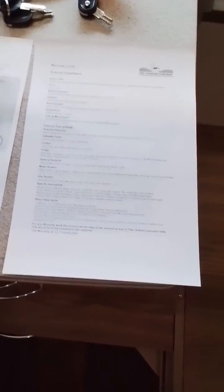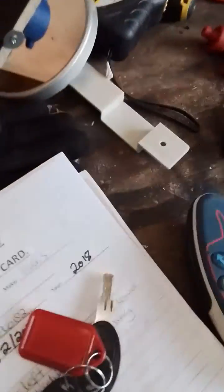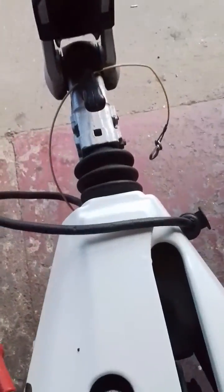Now for the motor mover. On the caravan you have a Power Touch Evolution mover. So first you're going to get your bar and engage the motor to the wheel by pushing the bar from this side to that side. You want to get as much leverage as possible. Once it's engaged, you can release your handbrake, then put the key in the switch and turn it clockwise.